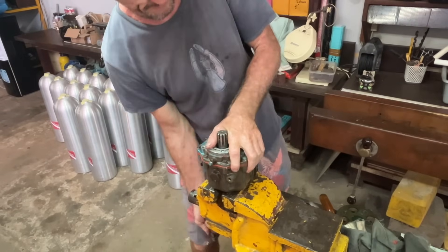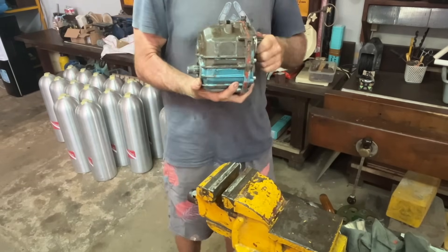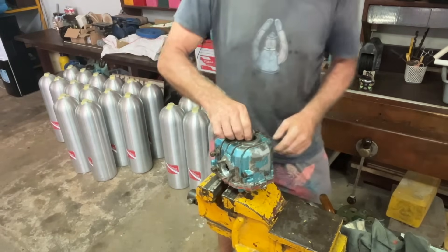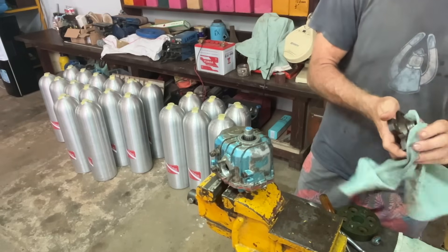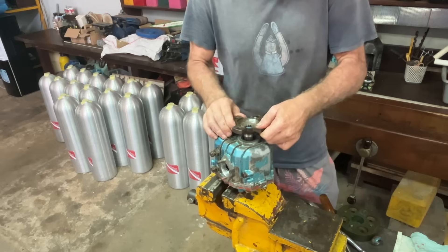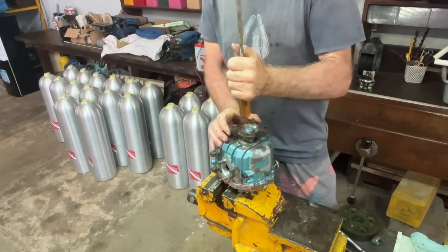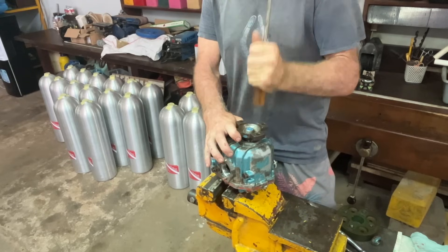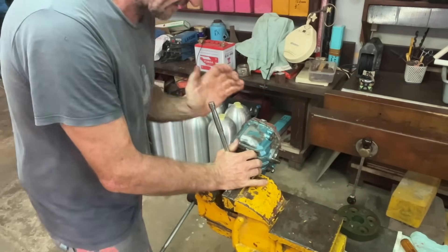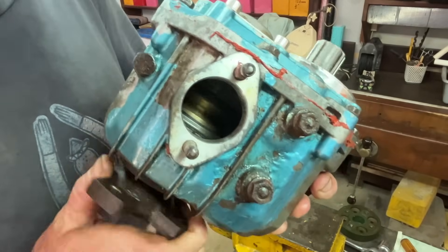Getting towards the end now. Take it out of the vice, give it a shake, and you'll hear it all rattle around - but it's nothing, it's just the clutch going forwards and backwards on the shaft. Flip the gearbox over and put the coupling for the prop shaft on. It's a bit tight with the oil seal - whack it on with a soft hammer or the back of a screwdriver, but make sure it goes on really straight. Get that big bolt real tight and give it a back bash with a cold chisel at the end to lock it.